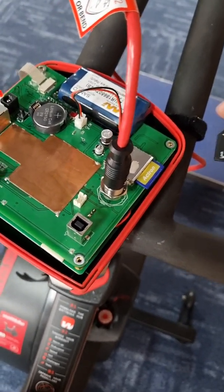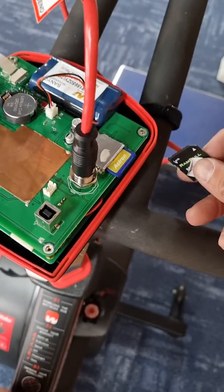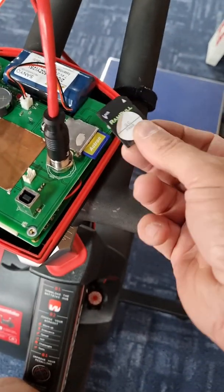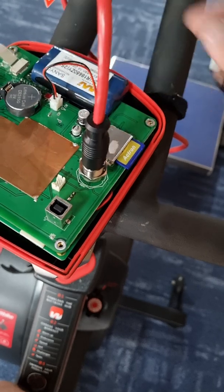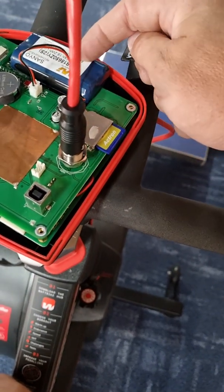When I first got to this job I was thinking it might be the batteries that were freezing the screen. After replacing those two batteries I then came across the SD card fault. So replacing the batteries also fixed a future potential issue — the SD card was the actual root cause, and now it's fine.